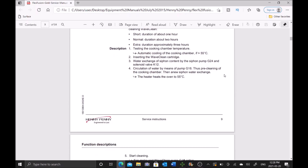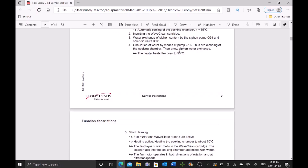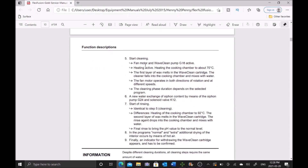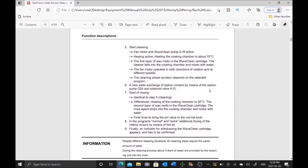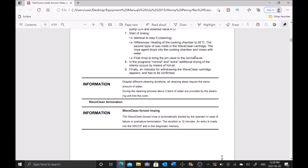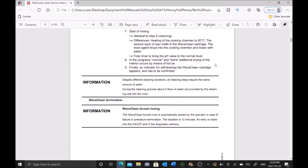It's going to tell us to put in a cartridge. Then our siphon pump and our K12 quenching solenoid are going to run. We're going to fill up the box and then pump with our G16 pump. Then we're going to heat the oven to 55 degrees Celsius. There is a steam mode function in that, so we have to make sure steam is working on the oven. Then we start cleaning — the fan motor and the G16 pump run, heat to 70 Celsius, and so on. We remove water from the quenching box and refill it via the G24 pump and quenching solenoid valve. Then we heat the cavity to 92 Celsius and start the final rinse and drying process.